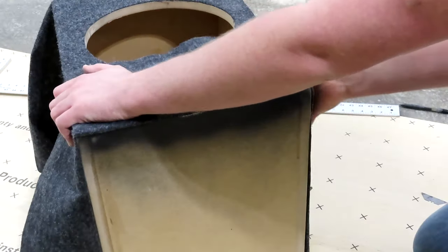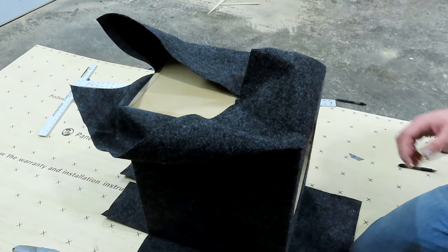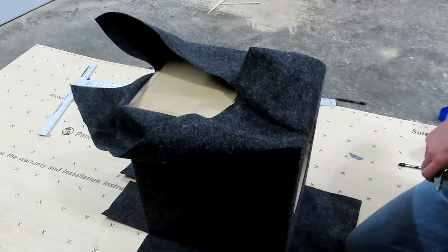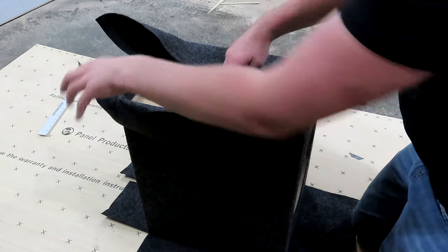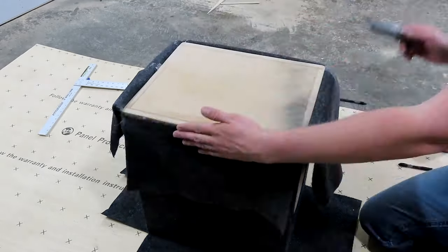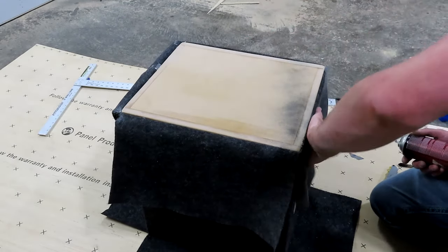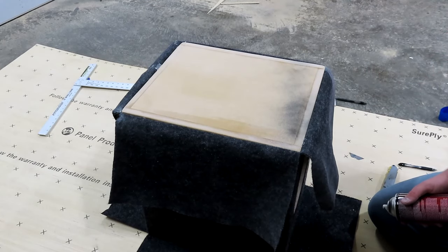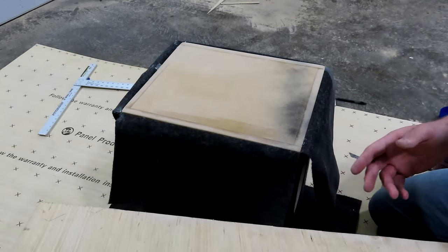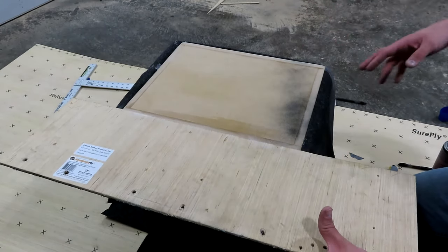Take these flaps, put them up the sides and put that on the bottom. This final fold is arguably one of the hardest ones to do when carpeting a subwoofer box. Apply more glue — make sure your flaps are nice and down, don't get too much overspray on the flaps, just focus on here. You'll probably see me using a piece of scrap or cardboard to put up against the edges and cover the flaps while doing the glue.